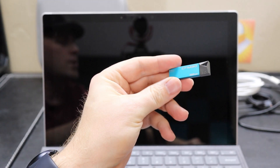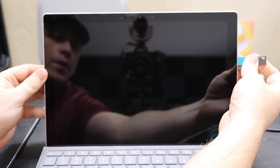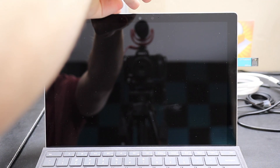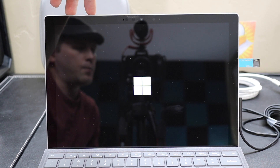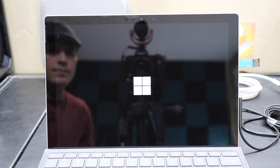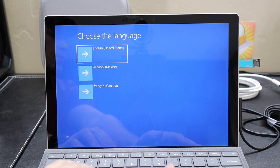Okay, so you're going to take your Surface Recovery image that you've downloaded from the Microsoft website — I've made a video on how to do this and I'll put a link in the description. You'll drop your USB with the factory firmware on it, then hold the volume down key and press the power key until you see the Windows logo appear. That's going to allow it to boot from the USB drive.